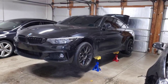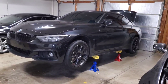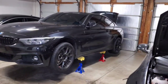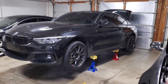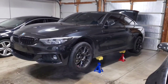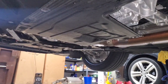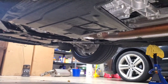The first thing I've done is jacked up the car as high as I can — try to get it at least two to three feet in the air so you have room to work. Then I've opened up the trunk and removed the negative terminal on the battery, because under the car you will have a couple of connections to remove, so just pull that off so you don't have any electrical issues.